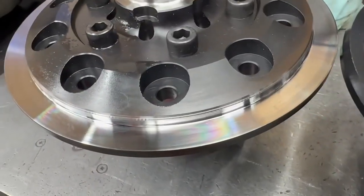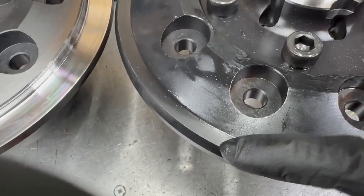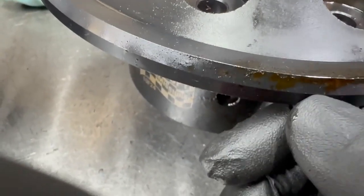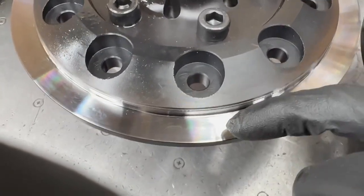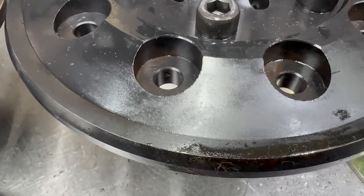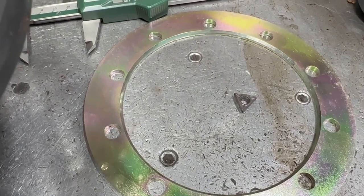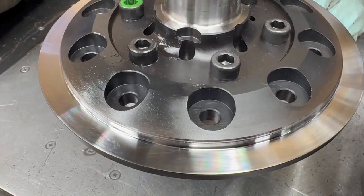The way we do it is to spend a considerable amount of time on the lathe machining this angle here flat and going in so that we've got enough flat metal to actually sit the pad on, while still retaining the thickness here to add support to the back of the crown wheel. The problem with doing this is twofold: one, this is incredibly hard metal, and two, it takes a very long time to machine down. But we get a lovely finish on there. Time is money — it's easier just to chomp it flat, or grab a long nose with an adapter plate. Here's a broken tip off my lathe, because these are so hard it tends to go through tips.